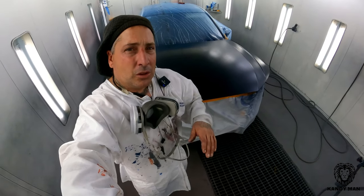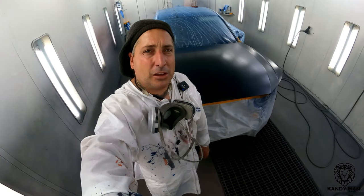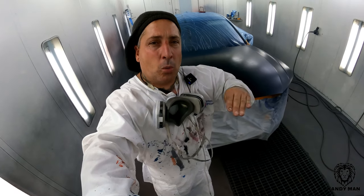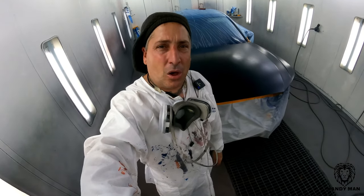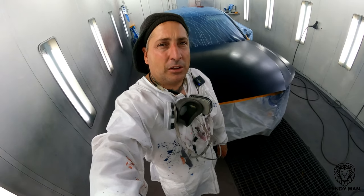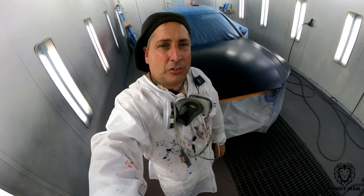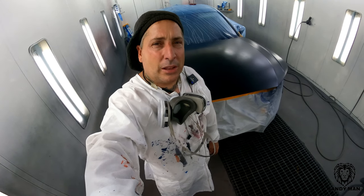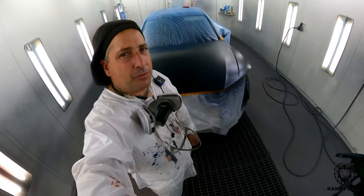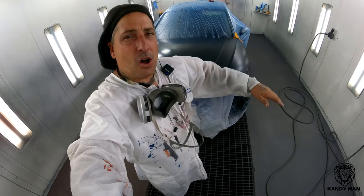It's like the old school waterborne primer that they used back years back, if any of you guys know. When they had a problem with reactions, they'd always use a water base to seal that panel off and avoid any chance of reactions, like on the old Saturn parts, because it would eat right into that because of the aggressive solvent from the urethane primers and the old lacquer primers. So they'd use a waterborne primer on that and some other different parts and cars through the years to seal everything off with a waterborne.